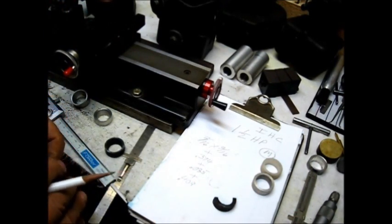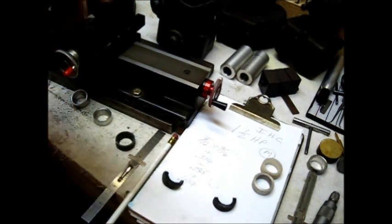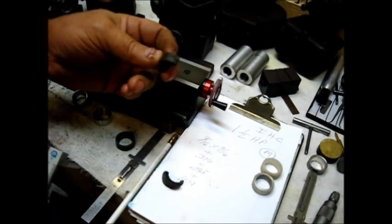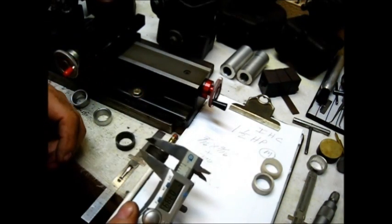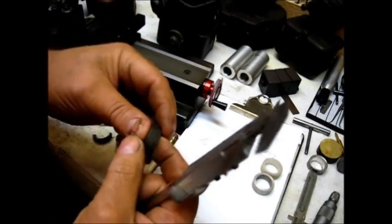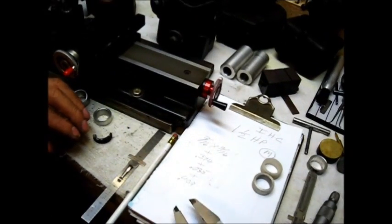That way you'll have a good, tight-fitting venturi. You do not want the sleeve to be too tall — the two pieces apart is the point here. I've taken probably 40 of these apart and you'll be hard pressed to save an original; they just break right in half. But if you measure a broken one together like this, the height will be around 400 thousandths. This one is actually 396.